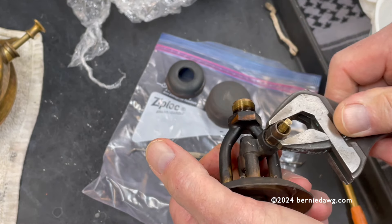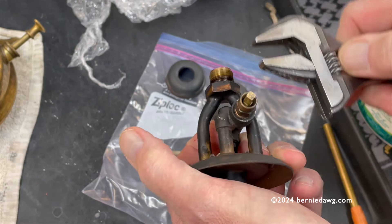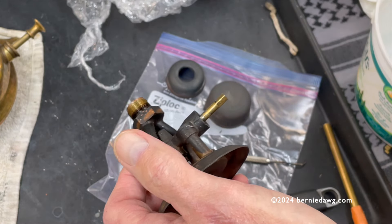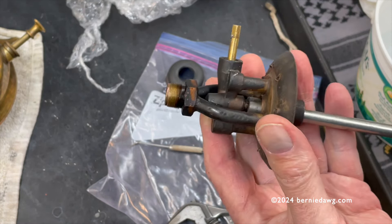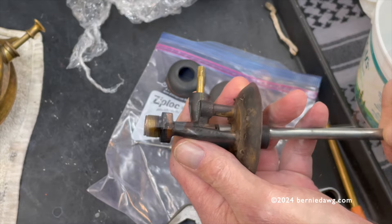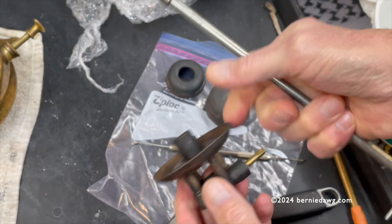As is often the case, there's a roll of mesh that's gotten really gross and dirty in the base of the burner. I went ahead and cleaned that before I put it back in. We're going to disassemble the burner using just a common tool to remove the spindle nut. The burner was shipped to me without a cleaning needle in place, so after I've removed the jet here with my spiffy jet tool, there's no cleaning needle to come out.